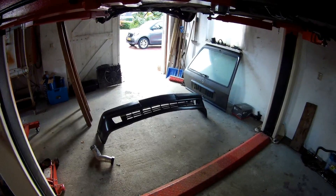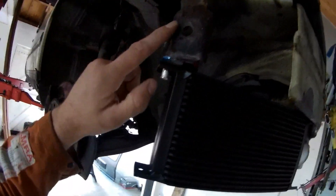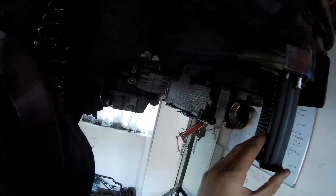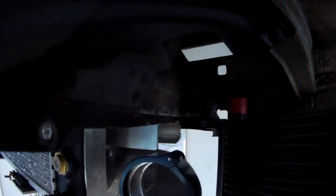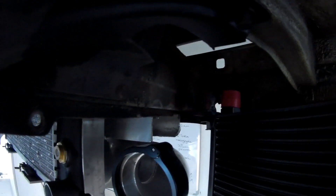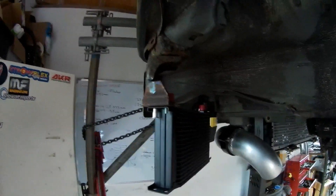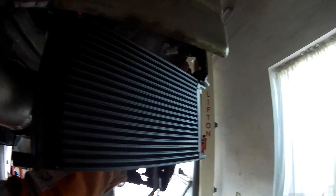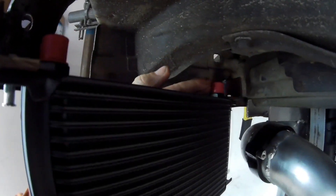The bumper is disassembled. I've got two brackets — this is the bracket where the bumper normally sits. I made another bracket for this on this side; it's just a mock-up bolt to hold it in place. There's also one on the back side. In the middle, the bolt for the bumper comes through. The fit is pretty good like this, same on the other side — it's just a mirror placement. Same bracket on this piece; it all needs to be painted.